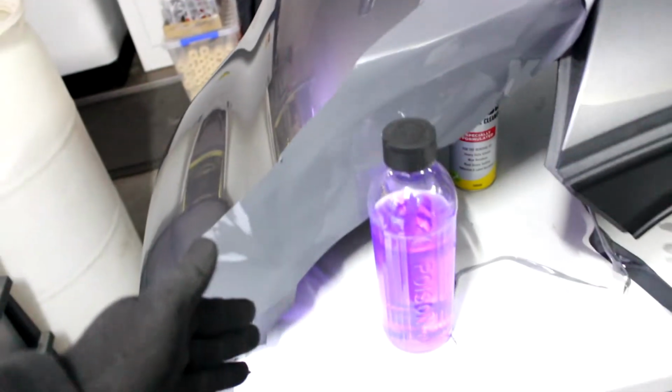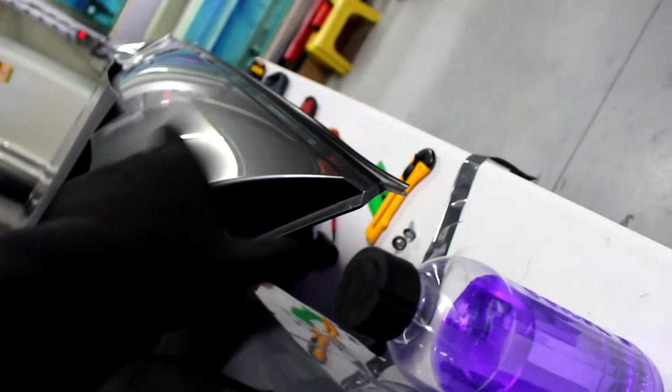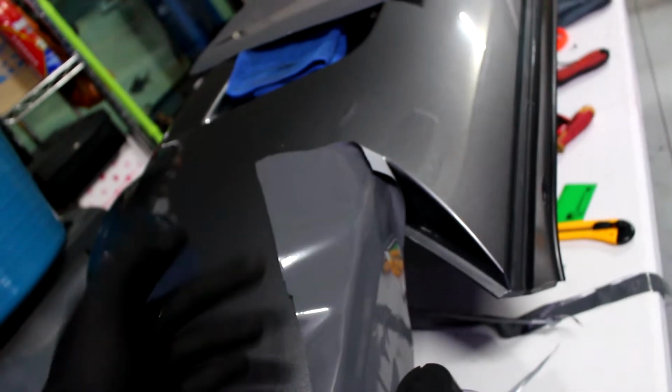What we have to do now is just the bumper. We're planning on tackling this in a few ways. This is just scrap wrap that we might be able to use, but where the bumper sits, it's super aggressive in this bend. So what we're planning to do is put an inlay just in here so that we don't have to pull the wrap all the way in and have a lot of tension. Otherwise that's just gonna bubble up in the corner there and peel off.